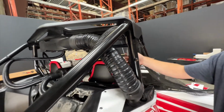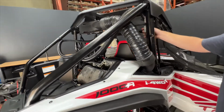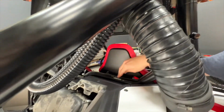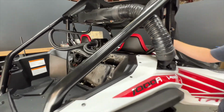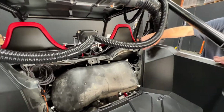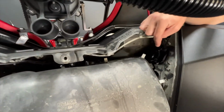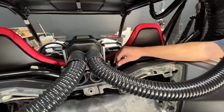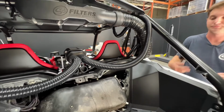Down below that, you'll see another wire running. That's going to be our ignition sensor. So we're going to run that down the cage, back through the same spot, make a turn heading this way, and we'll jump underneath the car, and I'll show you where our ignition sensor is going to hook up to the spark plug wire on this vehicle.